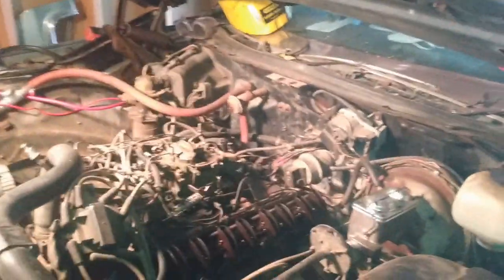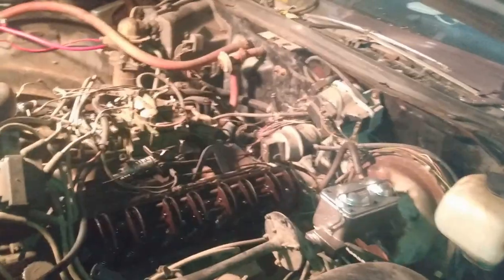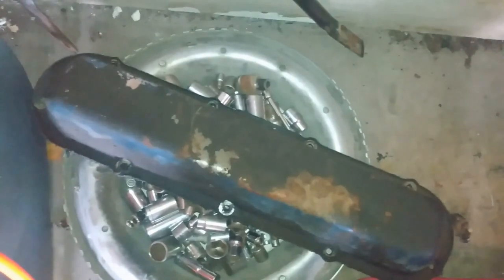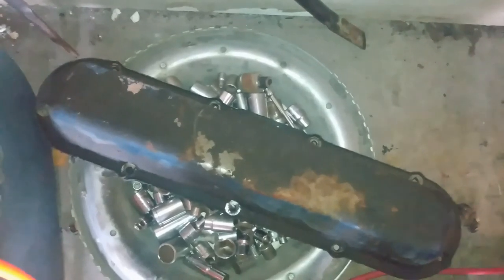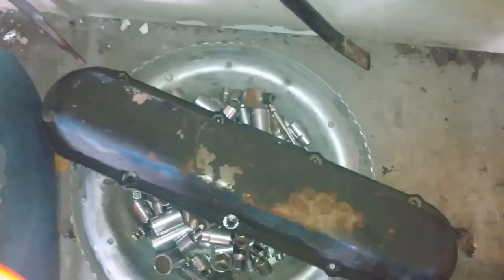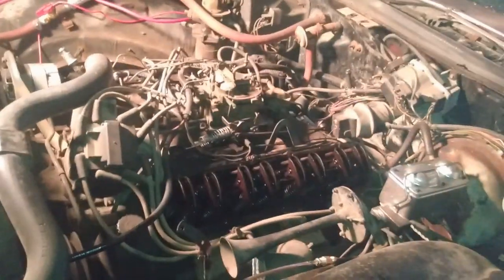And I've got to get my valve covers ready for it to be put back on. Now, they didn't have valve cover gaskets, but they had this stuff that's on a roll and you can just cut to fit. Usually you do that for differentials or odd-shaped ends, but it'll work for valve covers if you want to take the time on it, so it won't be that hard. It's cork. So while that's hauling itself out, I'll get that ready.